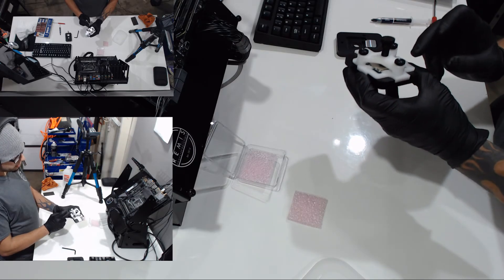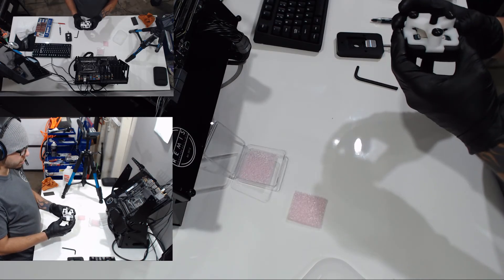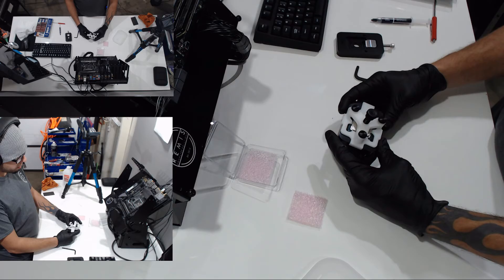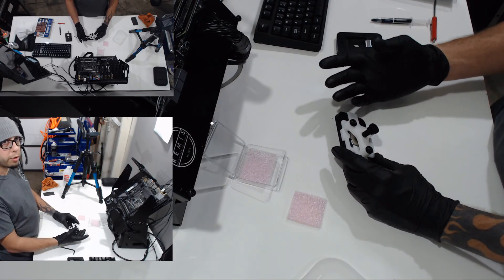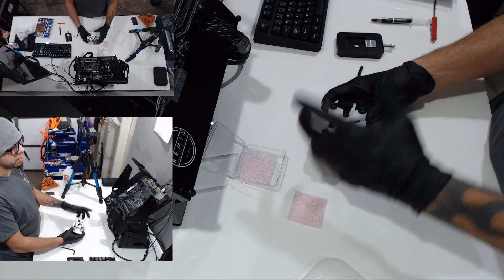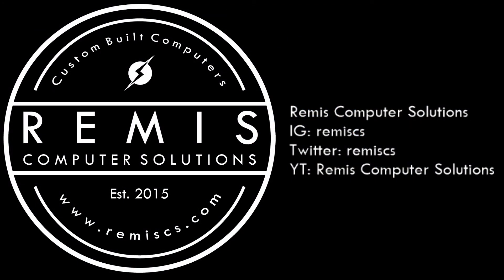And that is it, guys. When this silicone is cured, it'll be essentially like an OEM installation, but the advantage is we're going to have better thermal paste and this thinner layer of silicone is going to help the IHS sit a little closer to the die, so there's less thermal paste between the die and the heat spreader. If you decide to have this done on a client build or want to bring me a CPU, this is what you get with my deluxe service. The base service is just popping off the heat spreader and the client uses their own thermal paste. My deluxe service is exactly this, plus I do a baseline and after test with temperatures. Thanks for watching and until next time.